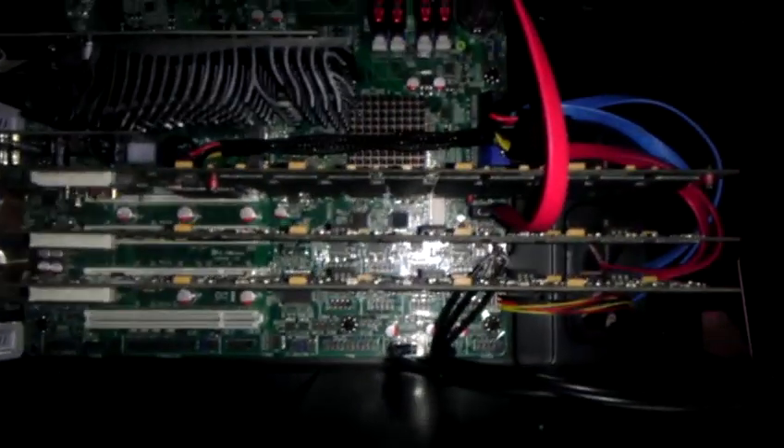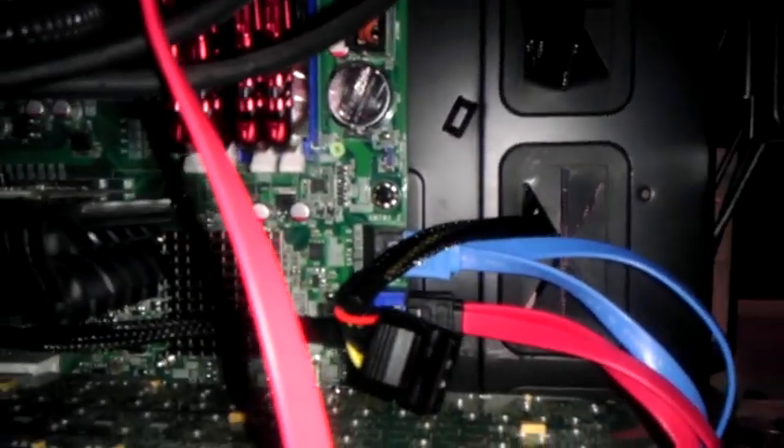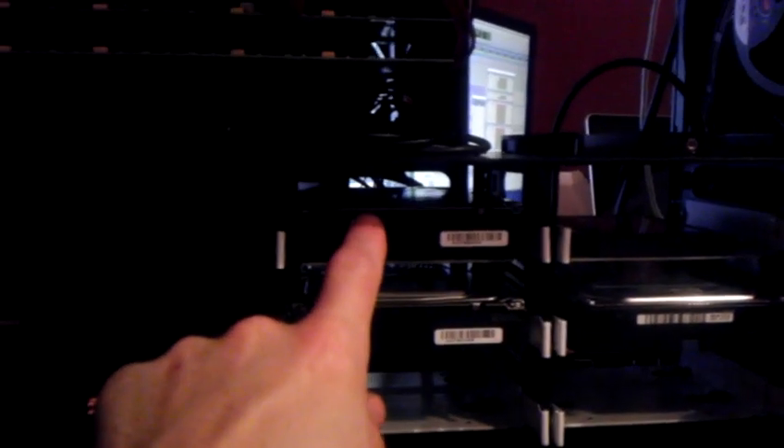This board just works really well for this. It has five SATA ports — two of them are SATA 6 ports (those blue ones) and the SATA 3 ports use the red cables. They go to a three terabyte and a second three terabyte Seagate. Seagate has some new drives that I really like the performance of — better than Western Digital Caviar Blacks in benchmark tests I've run, and I am a huge fan of Western Digital Caviar Blacks. So that says a lot, and they're not that expensive.